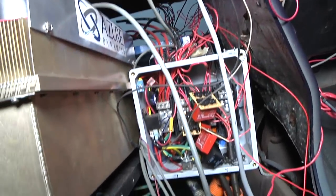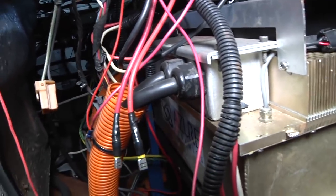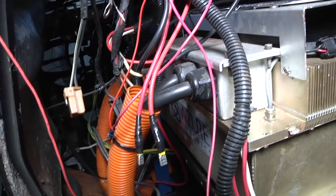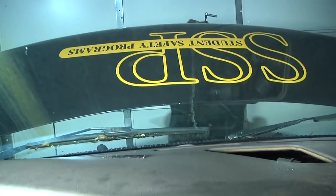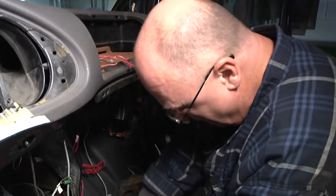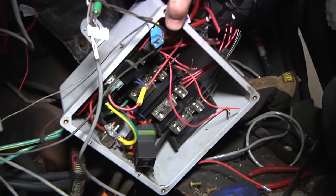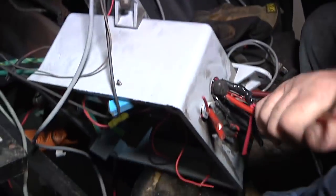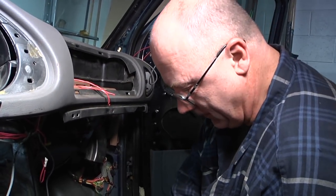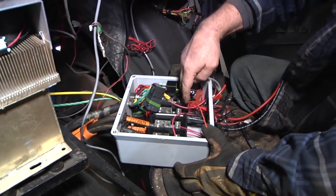Under the Azure Dynamics motor controller we're seeing the actual motor itself, and some of that orange split loom for our high power connections hooking everything up. We've got some auxiliary equipment, a lot of just small wires. We'll probably just chop all the small wires, snip snip, and then all those big connections we'll unscrew and properly unbolt them to make them easy to reuse without chopping off good lugs. Tom's already out there taking the hood off. He's pulling out the junction box where the batteries and all the other auxiliaries fed off of — all that weird custom stuff you've got to do for building a custom vehicle: air conditioner connections, power pumps, and all the little stuff. The battery probably came in here, then the controller went out, and everything else was just small tabs.